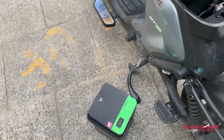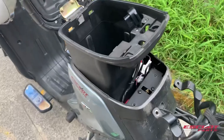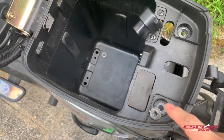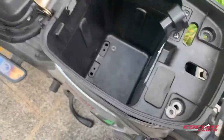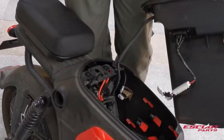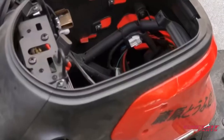The first step to access your motherboard: take your battery out and unplug it. Next, take out the four screws that secure the trunk into the scooter. You can take out the trunk and unplug the cables, or you can simply balance the trunk on the scooter.